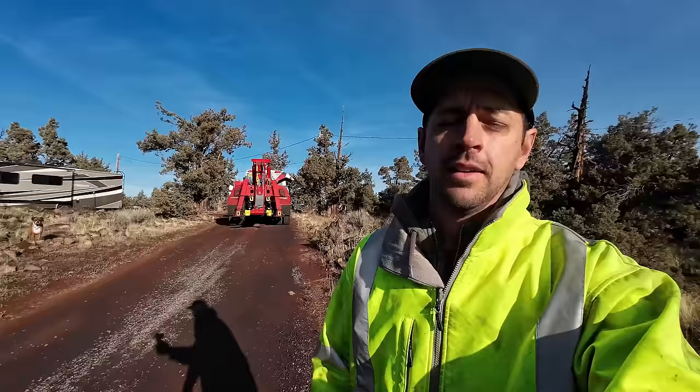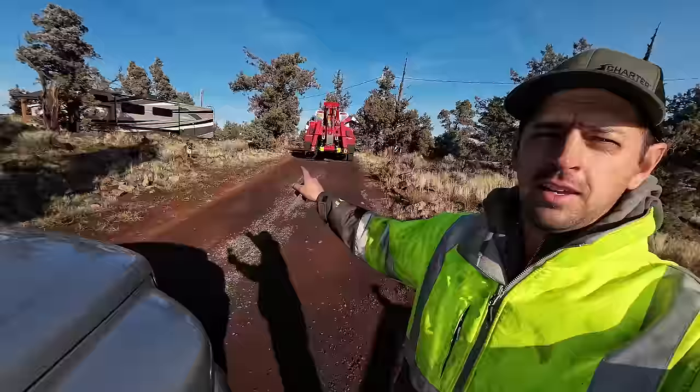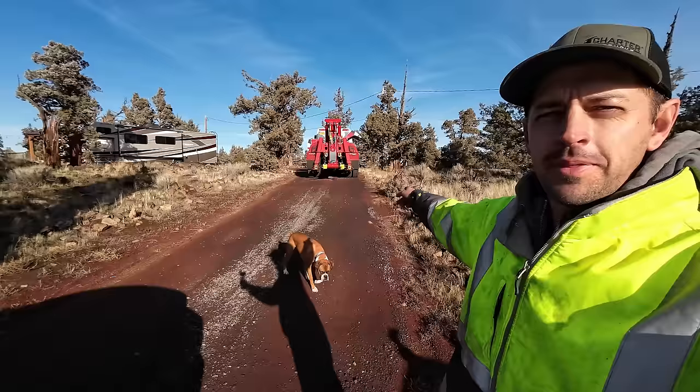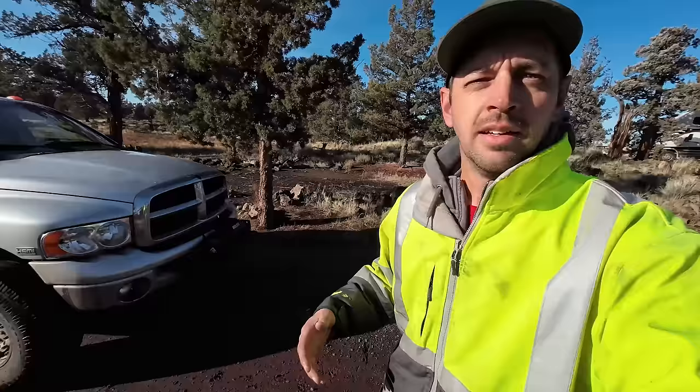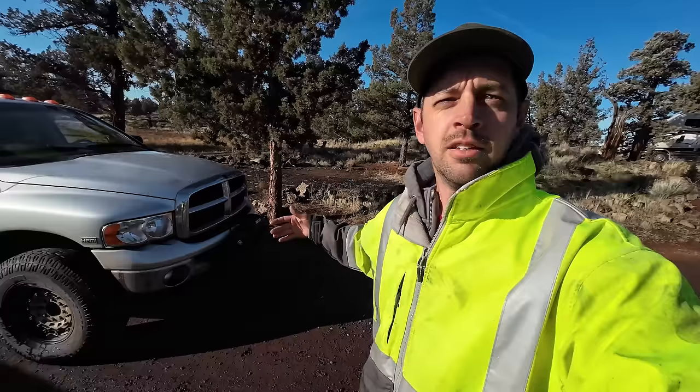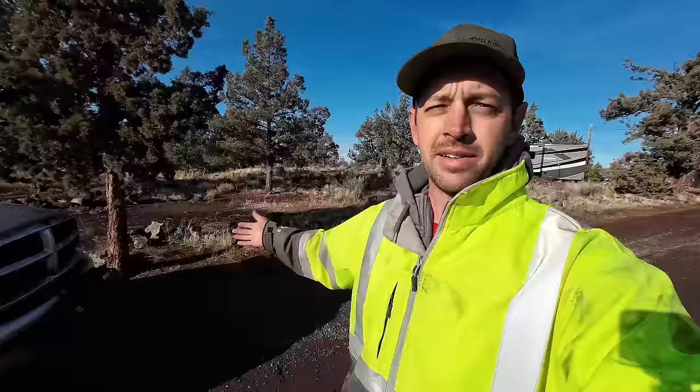If I am stuck here and my anchor point is up there 30 feet away, I need 30 feet of winch line to reach it. But if I want to go through a snatch block and back to my truck to double my power, I now need 60 feet of winch line. If I want to three-part this to give myself a lot of power, I now need 90 feet. Since 80 to 100 feet is about the average length of line on most consumer-grade winches — using 100 feet for easy numbers — you have to leave the bottom layer on the drum so your line doesn't slip, giving you about 90 feet of line to work with.